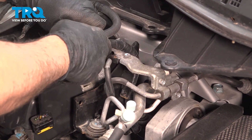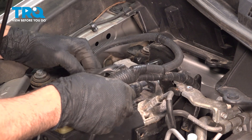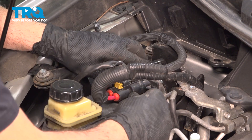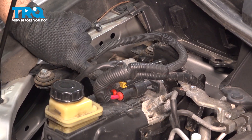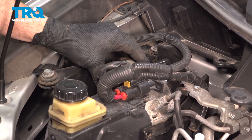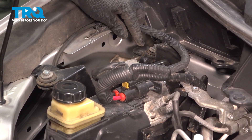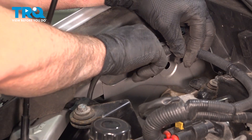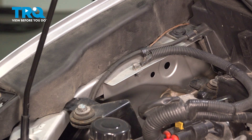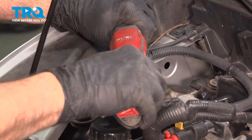Install your wire harness. We're going to line up our connectors here. Install the large connector and push that in — feel it lock in. Don't forget to push in on the yellow lock tab. Install the other connector beside it — you're going to feel and hear that one lock into place as well. Let's install our ground strap on the body. Grounding equipment is very, very important, so you want to make sure that the ground bolt and the body are clean. Make sure it's good and snug.